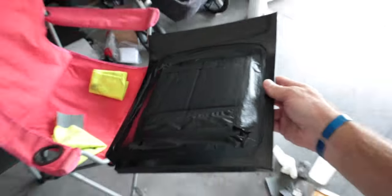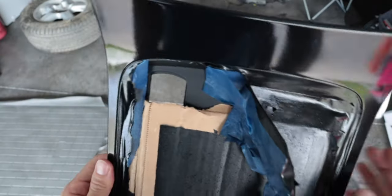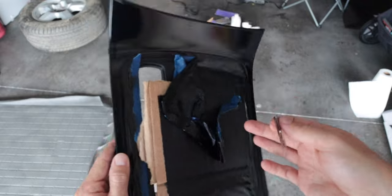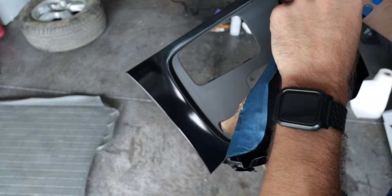I'm going to hit them with this Butter Wax and see how they look after that. Look at that shine! I'm going to take a razor blade to it to ensure I get separation here. I took the razor blade very carefully around the edges once again — let's try peeling this tape off. One mistake I made was leaving the tape on while everything dried. As soon as I was done spraying, I should have peeled the tape off. Instead I let it dry over the tape, which left some tape behind and gave me problems on the corners and edges. It also left some markings on the paint. I tried scrubbing it — it's not really coming off.